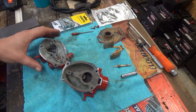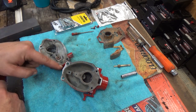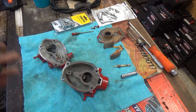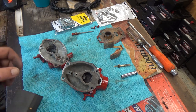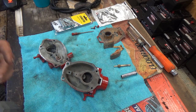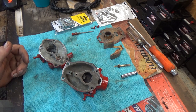You can already see these shiny spaces right here. What we've done is we've got a big honing block. You can also use a sanding block, like a vehicle sanding block or whatever. You don't have to use an insanely aggressive grit, but you also don't have to treat it like you're painting a surface, so you don't have to use ultra fine either. Just a medium coarse grit — 300, 400, 500, 600, 800 grit — something like that would be about the finest I would go.